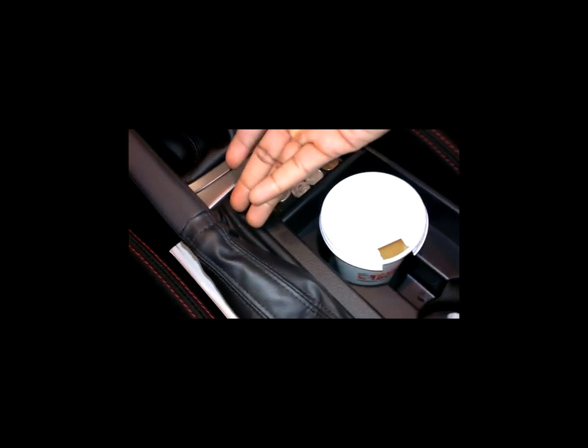So this is the center console. If you look in here there's two bolts or screws — undo those and it pops out. Then put the car in gear first, pop the e-brake down, and pull that away right there — it should pop out pretty easily. The next step is to disconnect the e-brake leather wrapping from the center console.